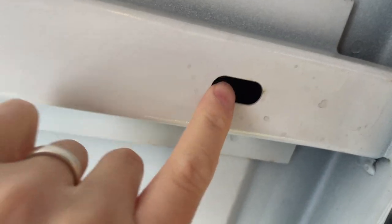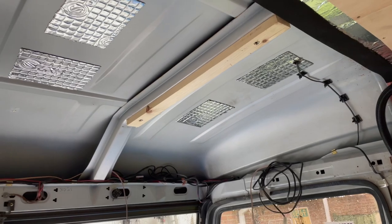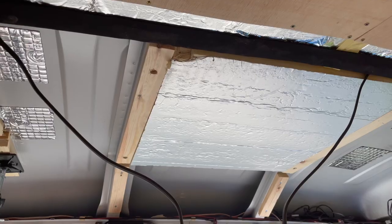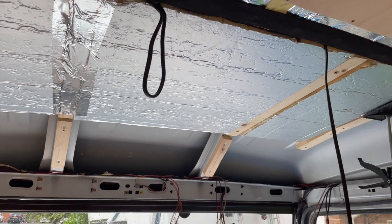There are already some holes in these supports which just so happened to fit an M8 rivnut perfectly, so I'm going to use M8 rivnuts in these holes — maybe not that one — and the same up here, so if I butt it up against this edge that'll be absolutely fine, and then we'll bond that wood on there too just so it's not going anywhere. I'm using 50mm foam board insulation, and anywhere where I can't get that in I'm going to fill all of the crevices with the wall insulation we used around the curved part of the rest of the ceiling.